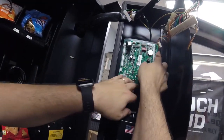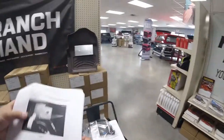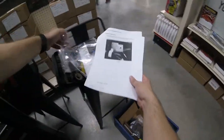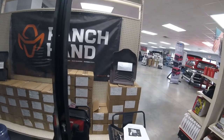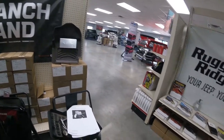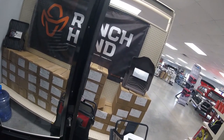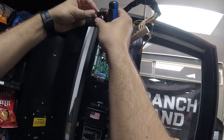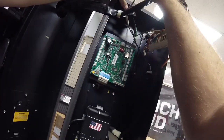It's time to mount up the VMC. We just pop it on to the same supports the old one used — it's really cool that they made it compatible with the existing supports. Now it's time to start making our connections: the DEX connection, motor connection, power connection, keyboard connection, display connection, and the coin mech and dollar bill acceptor connections. In the next video we'll come back with the credit card reader already installed and show you how to get the MDB codes and program your product map — it's going to be really easy.